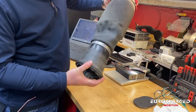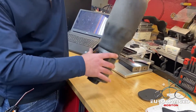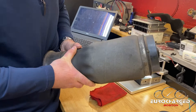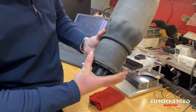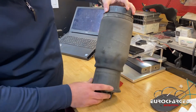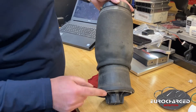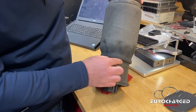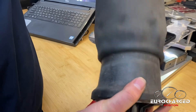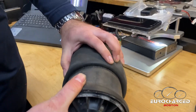Now the way it bounces up and down, just like a coil spring, is actually the rubber folds. This is kind of sort of how it goes in the car — this is the normal position. It has some range to expand and range to compress. The limitation of the design is you start to get road pebbles, dust, and grime on this plastic socket, and as the car is bouncing up and down hitting bumps, the dust starts to eat into the rubber right here.